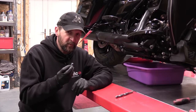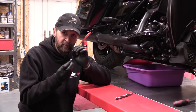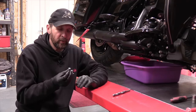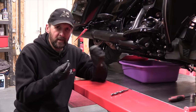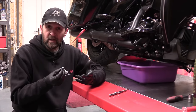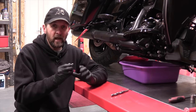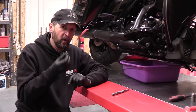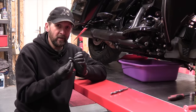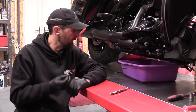Give the plug some love — it's well worth it. Make sure the thread is absolutely perfect, because down the line a damaged thread can strip the sump and cause all sorts of problems. A new o-ring is not negotiable; the manual stipulates always fit a new o-ring. A little bit of thread sealant is good — I like to use blue Hylomar, though you can also use white Teflon tape, or put it in dry and torque it up. Either way, make sure it's absolutely perfect before installing.